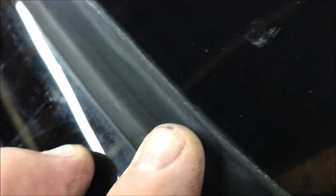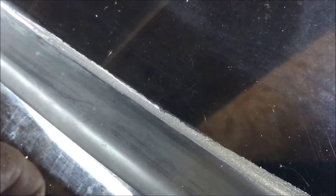This is what the finished product looks like. I have a little bead of gasket maker all along this trim piece where it mates with the roof of the vehicle, and I suspect that'll keep the water out until this replacement windshield finally fails.